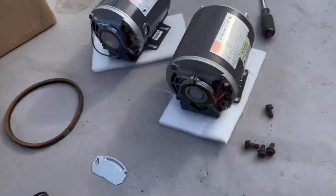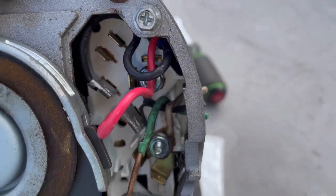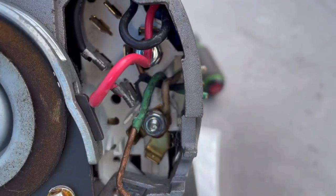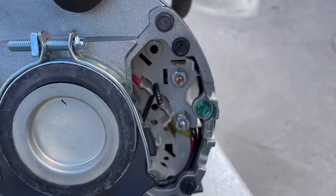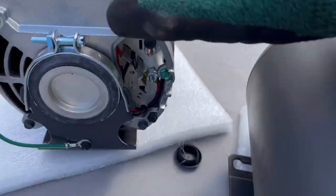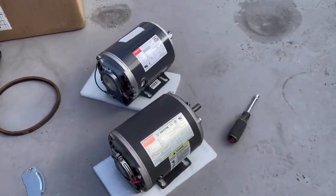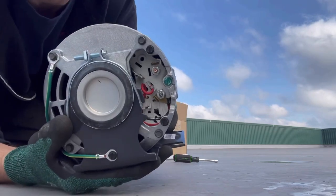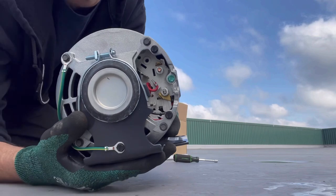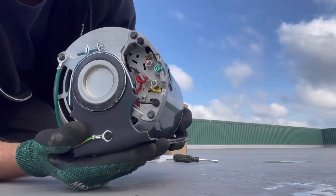I want them to match as the old motor. I can see that black wire and there's the red wire. Black looks like it's on number two, and red's on number five. The new motor, you can see, are different. So I'm going to interchange — just pop those terminals off and reverse them real quick. And that'll be good. Then we can go ahead and wire this in up on the fan, how it sits. Just like that, I reversed the leads, red and black, reversed them. Next, we can go ahead and mount the electrical, run through here and put our wiring back on where it should be.